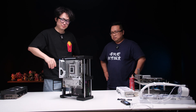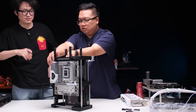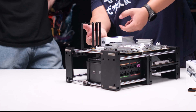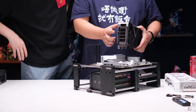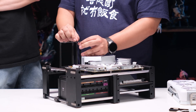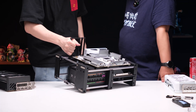What improvements are still needed functionally? One concern: since the water cooling hasn't been installed yet, will this main board position be easy to break out when water cooling is installed? I will solve that together with the water cooling installation method. The second point — when installed vertically, it seems only two-slot baffles can be installed and they are paired. But we have a lot of three-slot graphics cards on hand, so try to make it compatible with three-slot baffles. The most worrying thing when moving is that after plugging in the graphics card — a two-to-three kilogram object — it shakes from its own gravity, though grabbing the whole five-to-six kilogram unit and moving casually should be stronger than that.